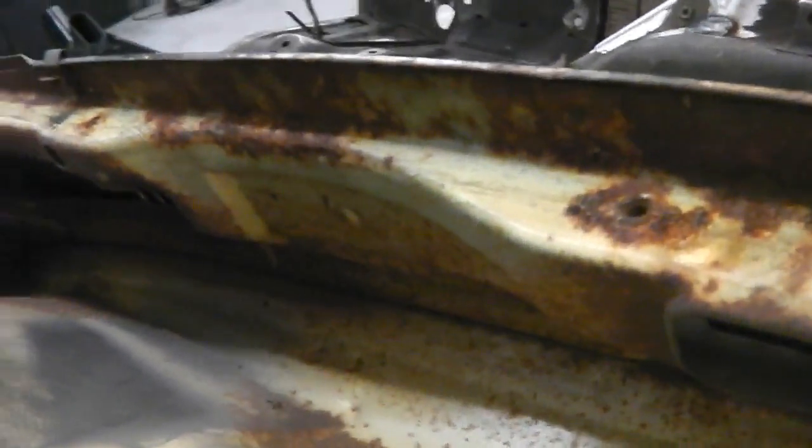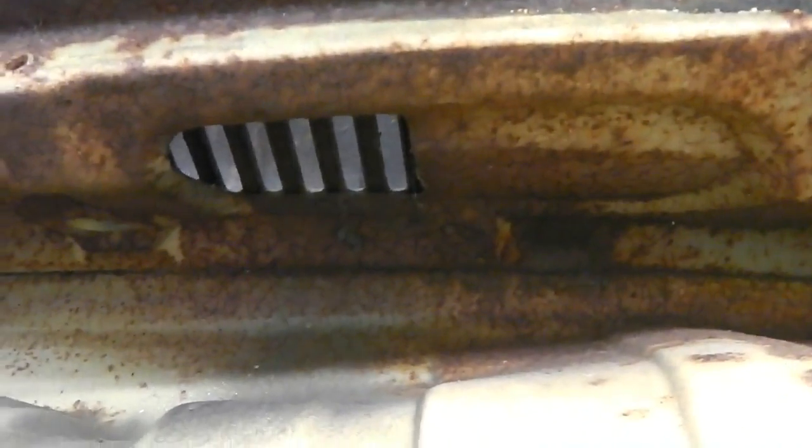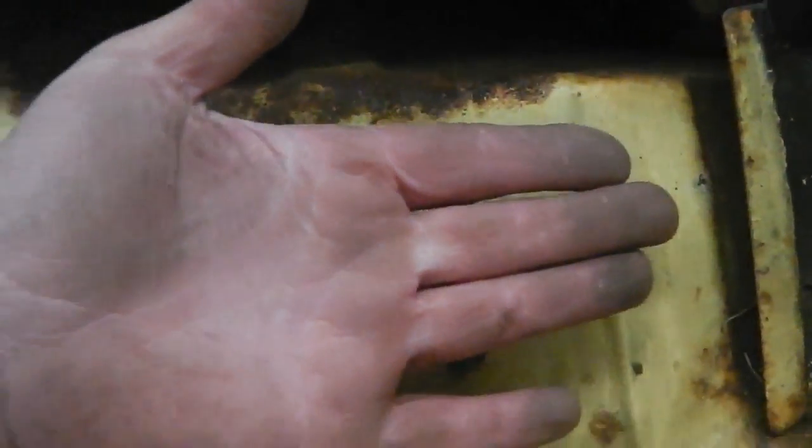So the heater box sits where my hand is now. And some closing panels up this end and the wiper motor forms an air chamber, of which we get ram air coming in and air drawn in under suction from the blower motor. But after the scuttle, they fit this separate panel which collects rain, and also, are we going to say that it diverts air into the appropriate part of the fan or not? We don't know. Now, here's the fan there, so that's drawing air in from this point, then blowing it down there.